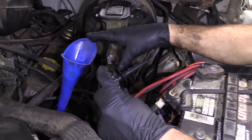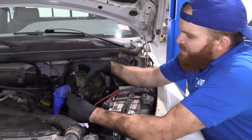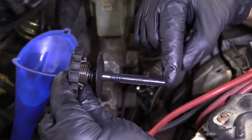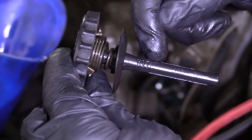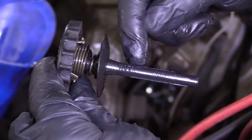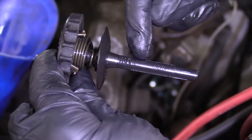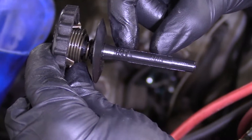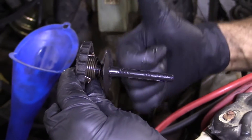We just added some fluid. Now you're going to run the vehicle and let it burp out all the air inside the steering system, then check your fluid level. On the dipstick, there's an add line with a little arrow down, and a hot line which is the maximum when it's hot. Once your vehicle's hot, you don't want the fluid anywhere past that hot line. If it's anywhere between the add and hot lines when the vehicle is hot, you're doing all right — just keep topping it off until you get to that point, then take her for a nice road test and down the road you go. Easy peasy.